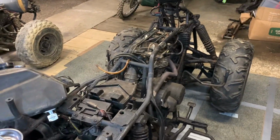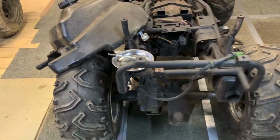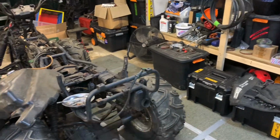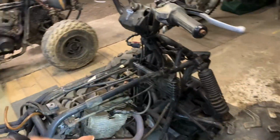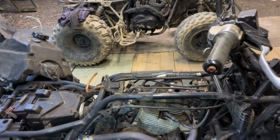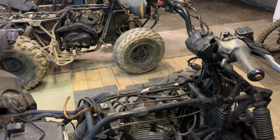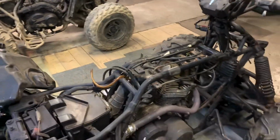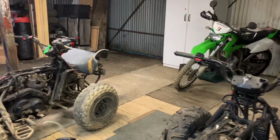It's crazy, this bike. And I didn't rev it, so I'm not dying of carbon monoxide at the moment, which is good. But if I start it, rev it up and everything, I'm going to get a lot of smoke. That might be because I put oil in the spark plug hole just to test the compression, to make sure it was above 100. I think it went up to about 110, 120, which was like, yeah, that'll do. So every time I run it now and rev it, I get a lot of smoke. I'm hoping that will burn out when I eventually get it over to the door, open the door, and when it's not chucking down with rain outside.